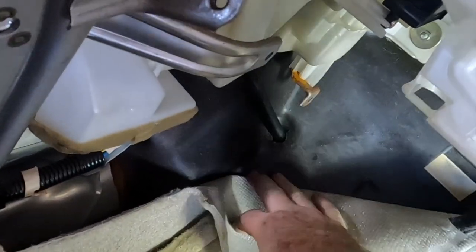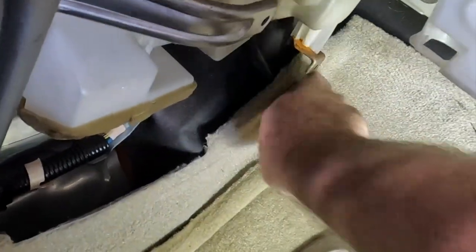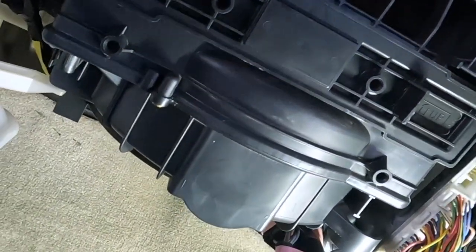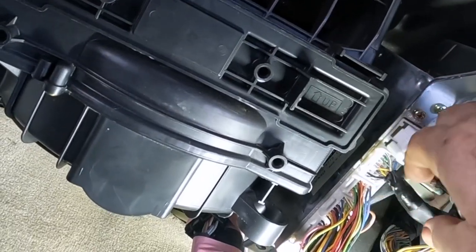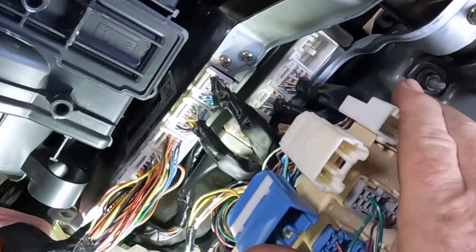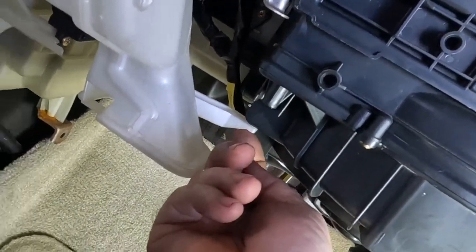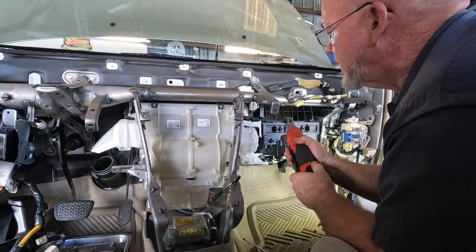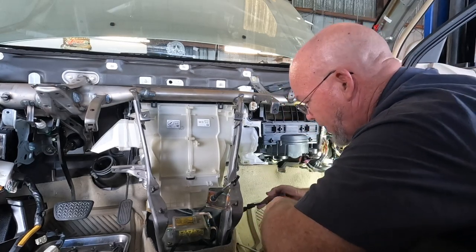The AC drain — I could have pulled it off the box here, but honestly I forgot about it. I pulled the box out of the car and it just pulled the hose out of the floorboard. There's a rubber grommet that goes through down there — make sure you put it back in place. ECM connectors — let's get those back in. The battery's still disconnected. These all go from the dash panel down.